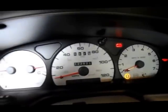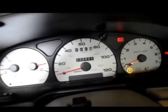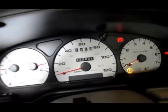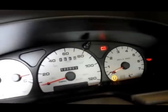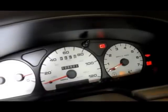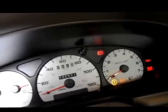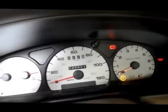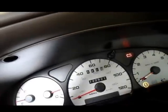I did what they call the wiggle test on here. You go around and wiggle the wires to find any that are broken or whatever. The car would start up and run perfectly, and then after a minute or two you drop it into gear, and it'll die right out and then it won't start again. We have the RPMs showing — the engine is spinning — and this is what I find really kind of strange.